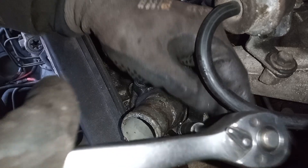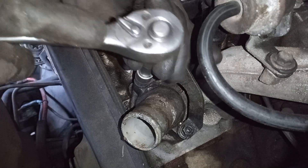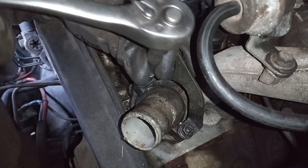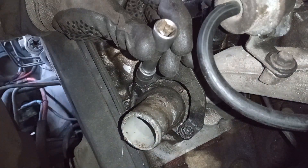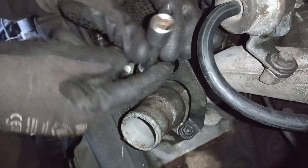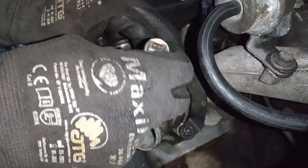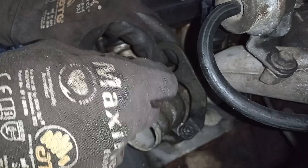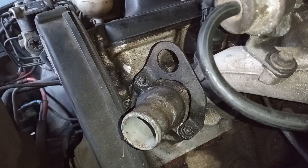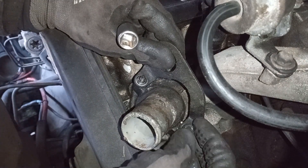This thermostat was a big one for me. I get rightly concerned about old thermostats — I've got no idea how old this is, and the car was sat for so long. It doesn't take long to cook the engine when these stay shut. But the gauge is running on the low side, doesn't really get up to halfway, so I think the thermostat's probably sticking open. I'll take it home and test it when my wife's at work so she doesn't catch me putting an engine part in a saucepan.